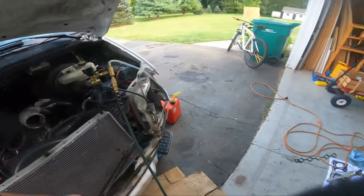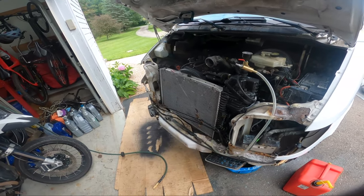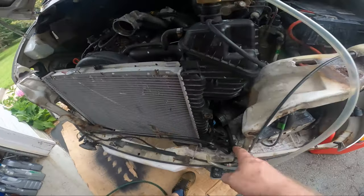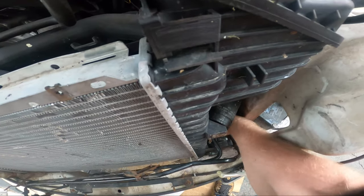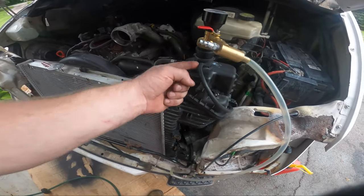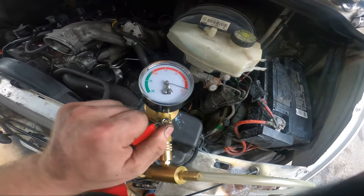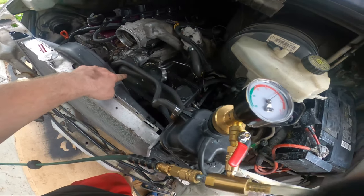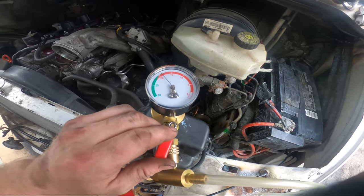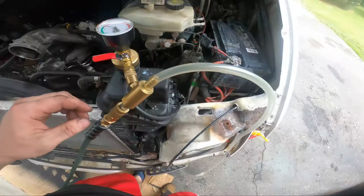It doesn't seem to be making vacuum. I almost gave myself a heart attack and then realized I'm a dumbass. I was messing with this thing for at least 10 minutes and couldn't get vacuum on the system — thinking, oh my god, what if the head's not tightened down flat? What if something got in there? What if there's a crack in the block? And I never screwed the drain back in on the radiator. So that'll do it — that'll keep it from making vacuum. I also switched to the cone because it goes down below the hole for the vent line for the overflow. I'll try this one more time. This vacuum looks more like it — it's going to start sucking the hoses down. It's supposed to get between 20 and 25. It's supposed to hold this vacuum for two minutes. It appears to actually be holding it pretty well.